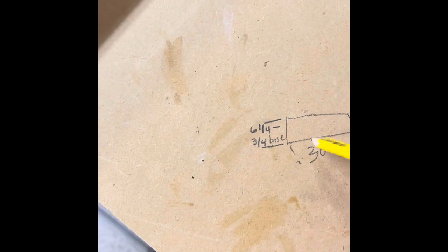The back side starts here and goes to here — I measured from edge to edge and got 30 inches, minus your 3/4 inch. Everything I used is 3/4 inch. The base from top to bottom is going to be 6 and 1/4 inches, but you minus the 3/4 inch base. On the front side, because of the new hump on the 2021 Sierra — I'm not sure about other years, this is the first GMC I've owned — I measured everything and it worked out great. I rounded the edge here with a 45-degree chamfer with the router.